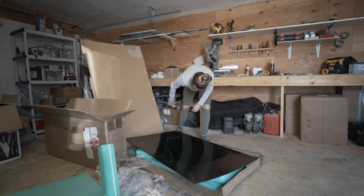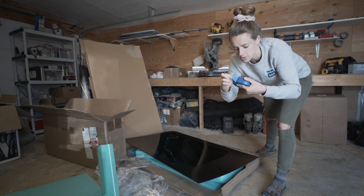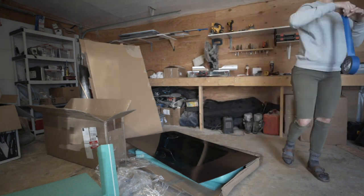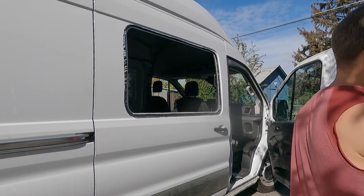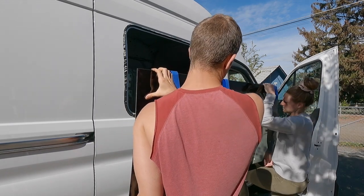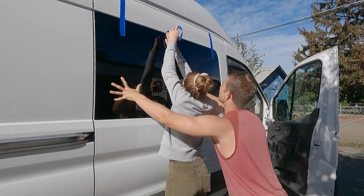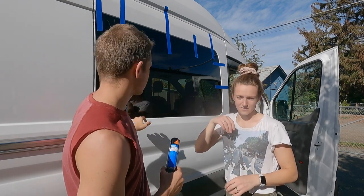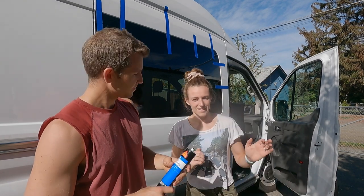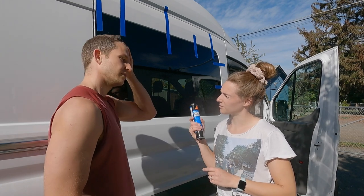While Tim is applying the adhesive, I'm going to do a quick run of glass cleaner over the perimeter of the window itself on the glass, just to make sure the surface is free of dust. Then I'm going to pop some windshield securing tape on the window while it's on the ground — that way when we hold it up to the van we can just press it down and hold it in place. We're really happy that we don't see any urethane adhesive popping out the ends. You would have seen us tapping on the window to get the glass in contact with the peak of the adhesive to create a nice waterproof seal. Now we have to wait for this to dry, but we'll move on to do the back ones.